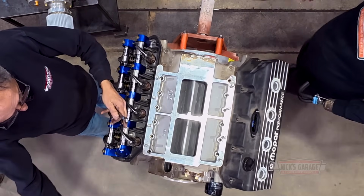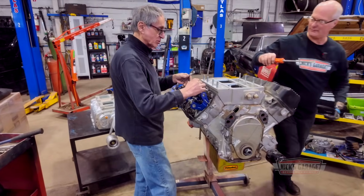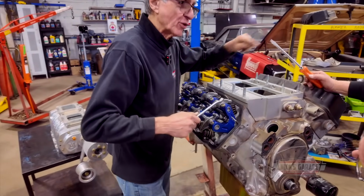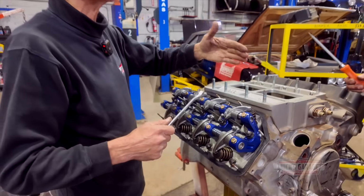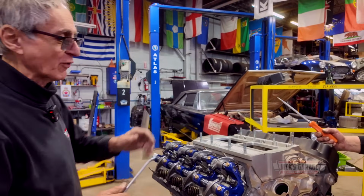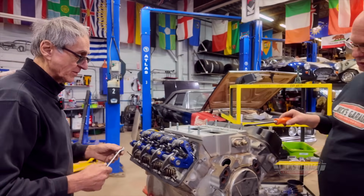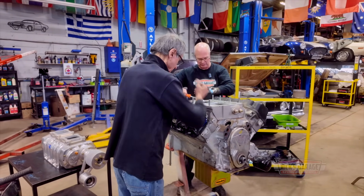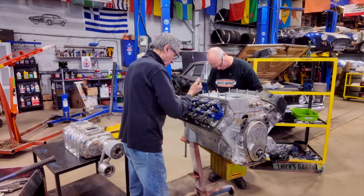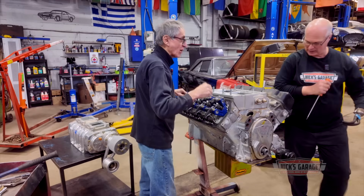Let's talk about this one. Looking from the front of the engine, as you open the valve, maximum lift should be 1/3 on the other side. Okay, so then when it's midway, it's right in the middle of the stem. You'll see, I think so far it's good. We're definitely going to go with a roller cam and new springs and everything because it's been sitting so long. Yes, that's right. But you can still use the same rockers. These rockers will do the job.